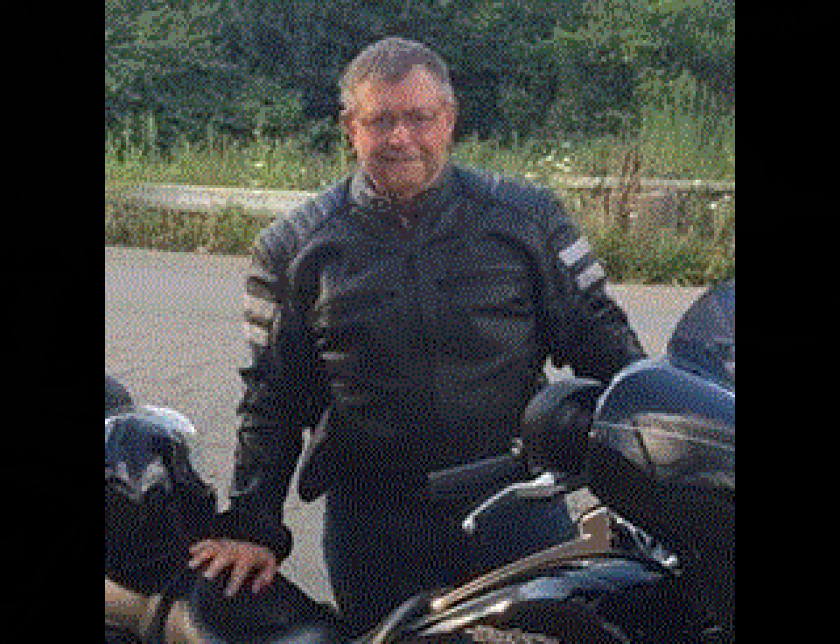Okay, we're back. The ride went well. The clutch is working — it catches about an inch to an inch and a half off the handlebar, which is just perfect for me with my hand grip. So it looks like the adjustment went well. Again, my apologies for the video issues with the camera not working and the background noise from the chipper. Thank you for watching — give us a thumbs up if you like, subscribe if you like, and we'll see you in another video.